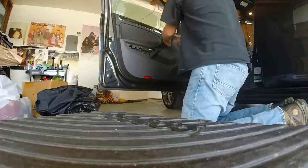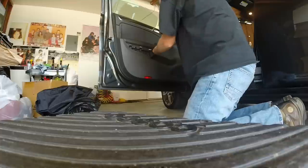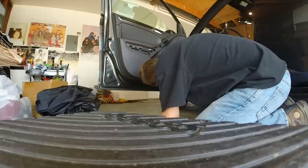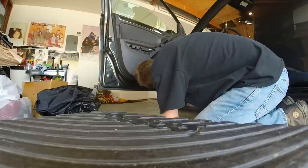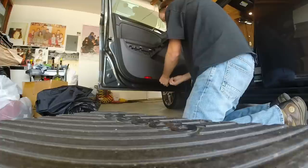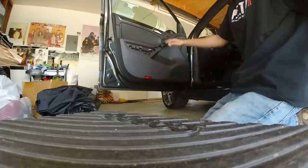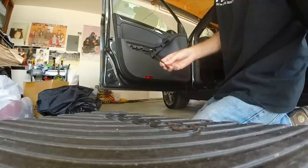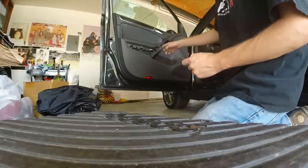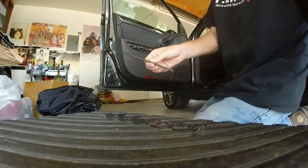Then you will have one, two, three, and four Torx screws. Your two door might have different positions, so make sure you check underneath before pulling too hard. By the way, this Allen is a really nice touch. A lot of times people will have a Torx socket, but sometimes you can't fit it in some of these holes — so the long Allen is needed.